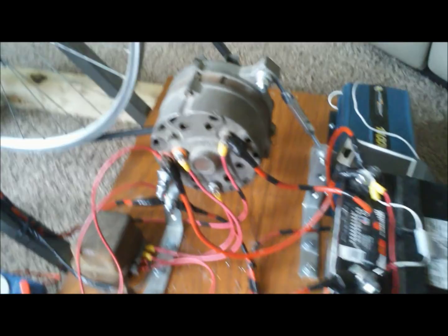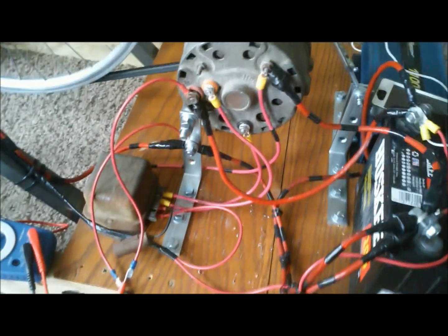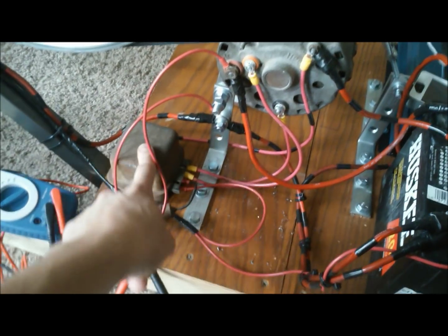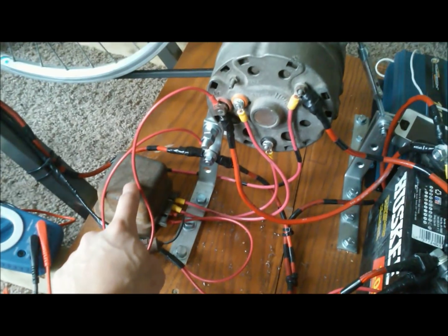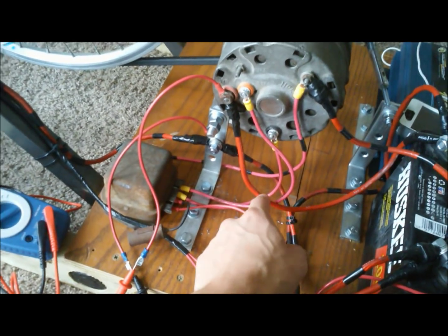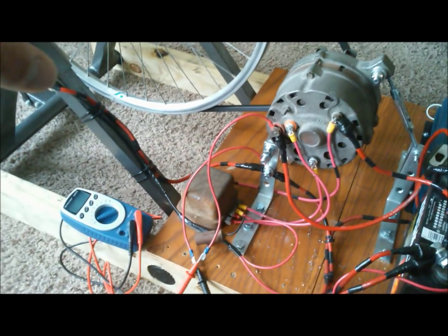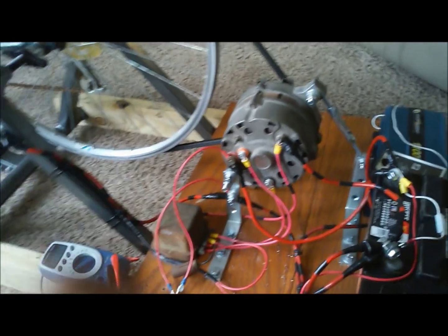The wiring looks really bad but it's pretty simple. Basically the inverter is hooked to the battery, and the battery is hooked to the battery terminal on the alternator. I just copied the wiring from my old F-100 — I pulled out my voltage regulator since I put a one-wire alternator in my truck. I have my external voltage regulator and I just copied the wire colors that ran from my alternator to my voltage regulator. Everything in black is a ground wire. I hooked everything in the system together and grounded it all so it would have the best ground possible, and that's shown to work pretty well.